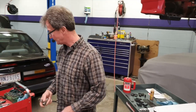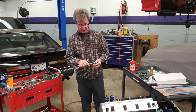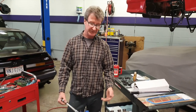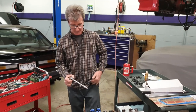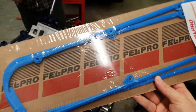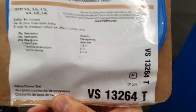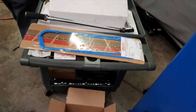How often when we're racing that car do we need to adjust them — after every race? Yeah, after every race. You don't really have to every single race because we also have a stud girdle which really keeps everything in line, so there's not a lot of flexing — you probably could adjust them every three or four races really. Depends on how many rounds you go. So if you're doing any of that, it's really good to get these reusable valve cover gaskets. We've been running these for a long time. Sometimes they do end up breaking and snapping, then you might just want to get new ones. But this is the part number for the 302 reusable ones, and we pretty much put these on every build we do because those cork ones pretty much suck.